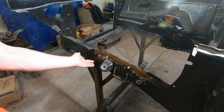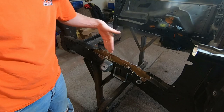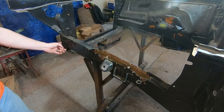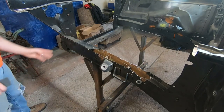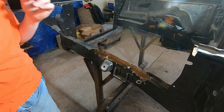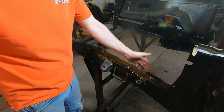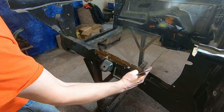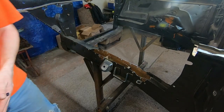And I've been filling holes like the one that's about 5/8 of an inch diameter roughly here. Some of the screw holes in the bottom of the frame, some other alignment holes in the bottom of the frame, some on the back side. I went ahead and extended it up to here, and we've got the bumper bolt bracket holes. Those are plugged up. I need to plug up the one on the end, and there's one on the bottom. Actually, there's two on the bottom right here. One over here, one over here. There's one on the side, I think, where the proportioning valve mounts up. And we're just basically going to isolate this area of the frame from about here forward and make a bath out of it. Really, is what we're going to do with this concrete metal etch.